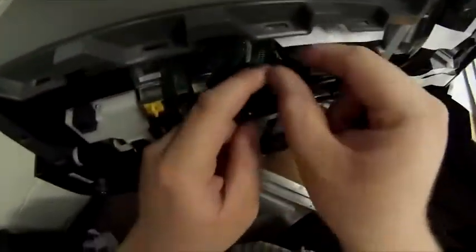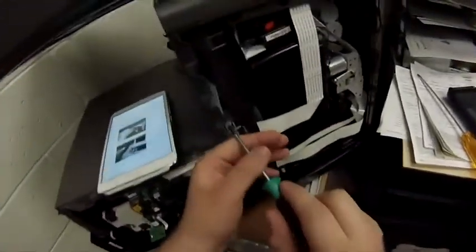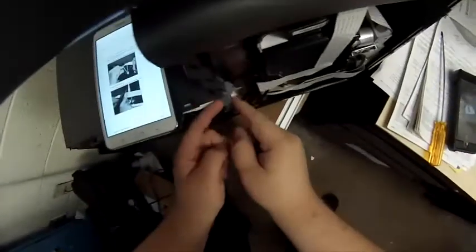Okay, now we're going to work with the cables. There's a large cable with a little clip. We undo that. We pull both black cables. You'll see later there's another white one back there I missed. But we're going to take this retainer off. Just taking a look at the manual real quick. I'm going to pull out this retainer here. It's just a screw, another T10 little wood-screwish thing.